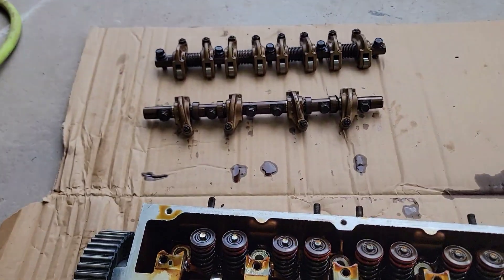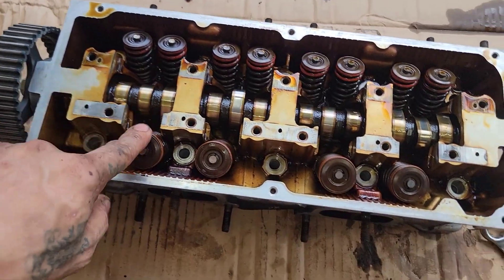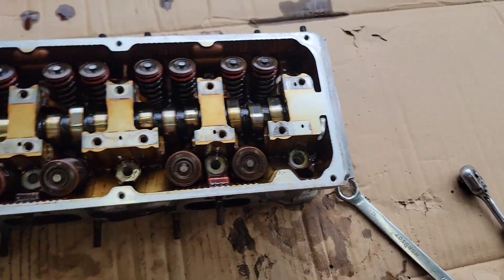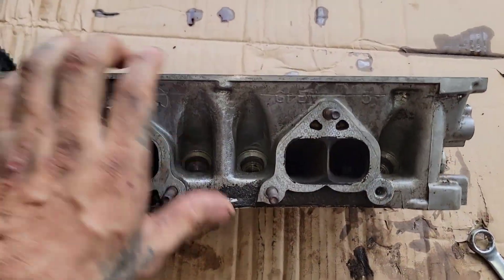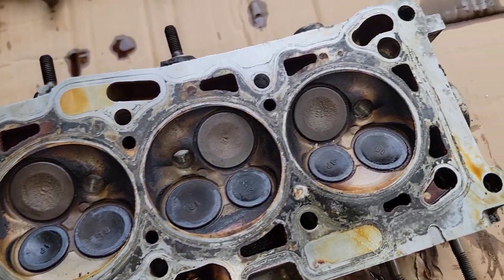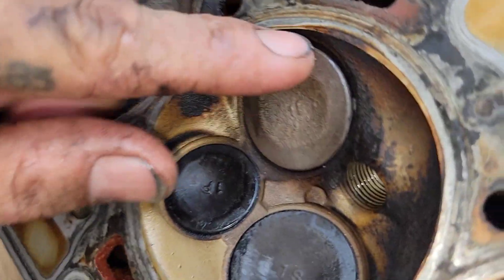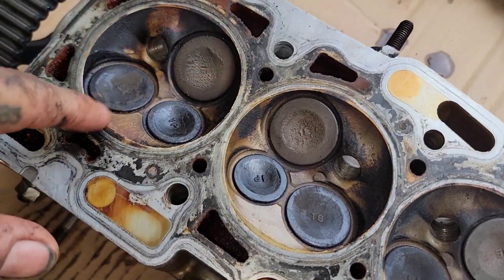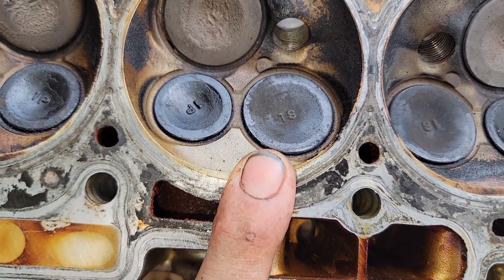Just to be sure, I took off the rocker guide — the lifter guide — and the cam is spinning freely, which means all the valves should close all the way with nothing holding them open. These two are for the cylinder I'm working on. I flipped the head over and I'm looking at all the valves — they're all properly seated all the way around. I'll put the spark plug in and fill it with gasoline to see if it leaks through. I checked these valves — supposedly one of them is the one that got hit — and then my phone overheated.